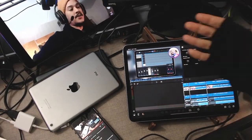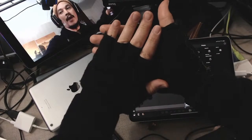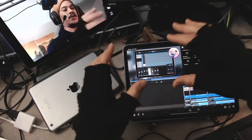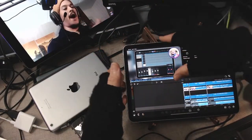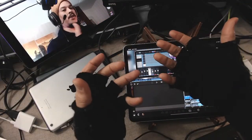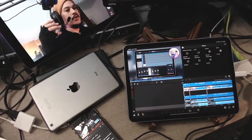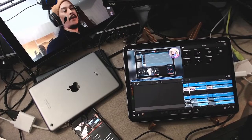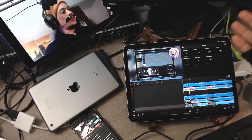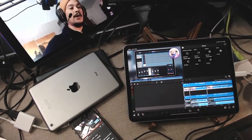You see, these screens have the digitizer and the glass glued together. Since they're glued together, you cannot just exchange the glass. You have to dislodge the entire screen with the digitizer and switch out the whole thing. That's why it's so stupidly expensive. And when it comes to aftermarket repairs for something like this, they started selling these back in 2018, so it hasn't been that long that these have been out on the market.